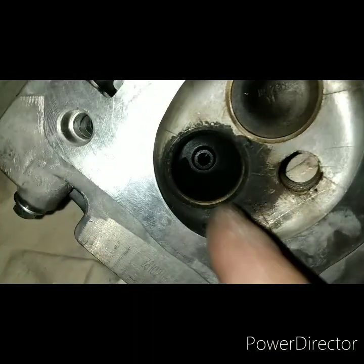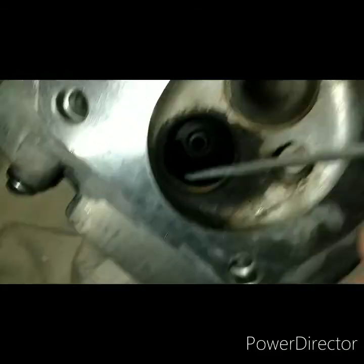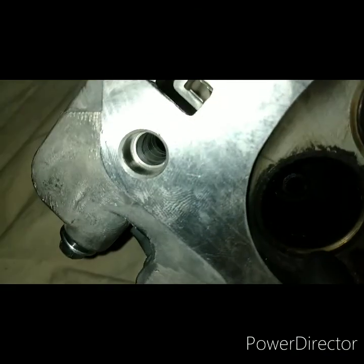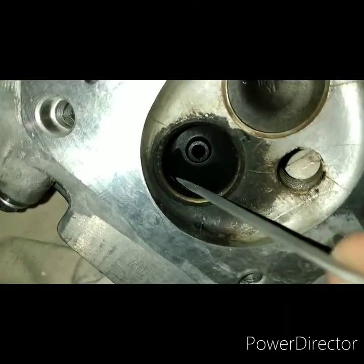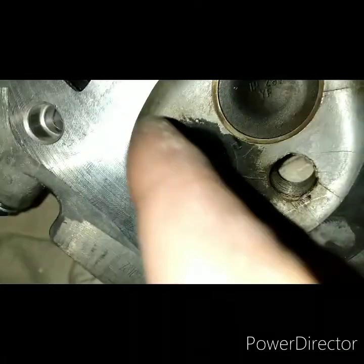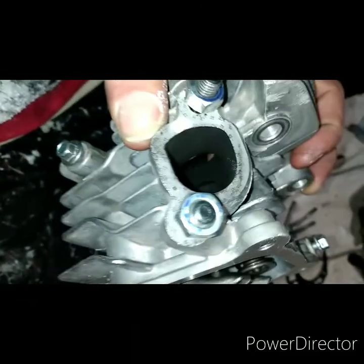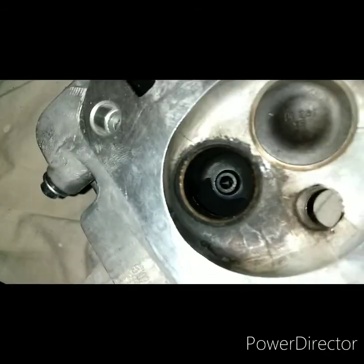This is the exhaust side. There's a lip under here — you want to grind that down just a little bit, round it off, without hitting your valve seats. Looking to get better airflow. Hard to do with one hand while holding the camera. All the edges around there that you can see inside — you can come through the exhaust port, same with the intake side. Round all the sharp edges, just trying to get better airflow. You don't want to change the airflow, you just want to get better airflow.